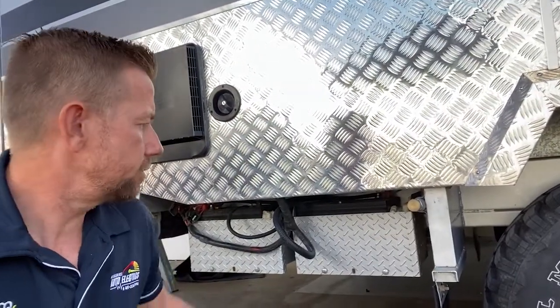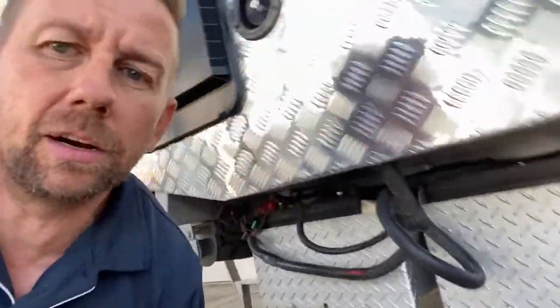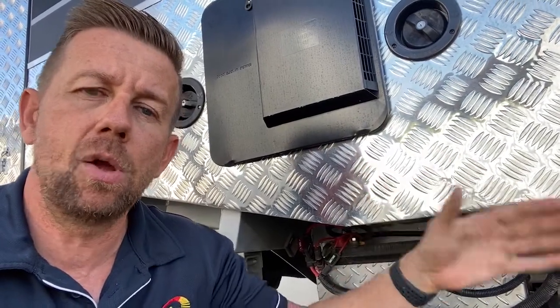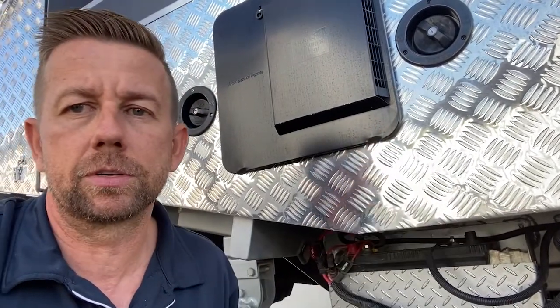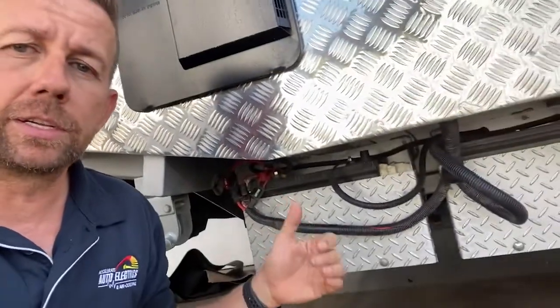Here we are outside the van. The batteries are currently in these two external cases. It's a bit of a disaster with a heap of multiple fuses, so we'll either pull everything back into the van and mount a fuse box inside, or mount a fuse box under here with bus bars and run everything inside. We're moving the battery inside - the cases are welded and don't sit well, and mounting the battery inside next to the inverter gives us a much shorter cable run between battery and inverter, improving efficiency and inverter output.